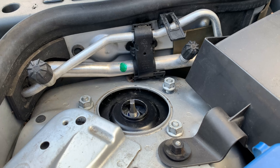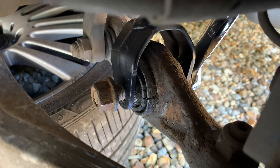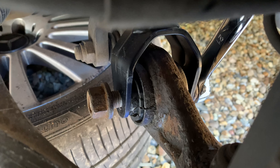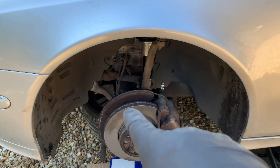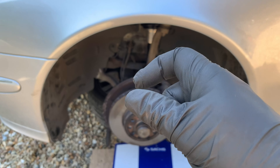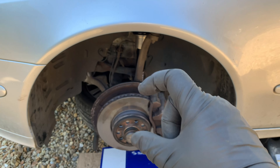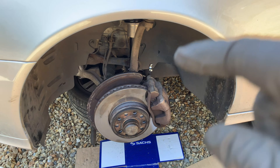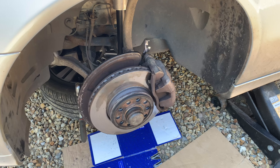I've pushed it up in there and just got to do up these bolts - super easy. Then we've got to move on to getting the actual shock back over the arm. The last thing is to do up that bottom bolt. I forgot to say: whenever you're finally doing up the bush tight, you need to set the ride height of the car first. If I do it too tight now when it compresses to stationary it will be under rotation. I've got to put an axle stand under the car, put some weight on the suspension, then do it up - that way the bushes won't be under as much stress. Otherwise the bushes fail way quicker. Sometimes the garage doesn't do that and after two or three years the bush is shot, when you could have got five years out of it.